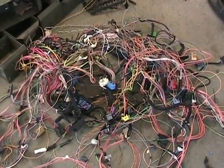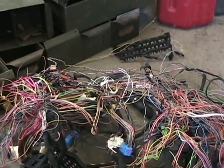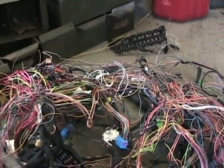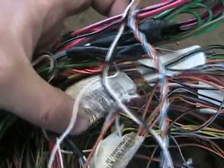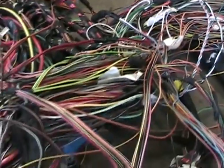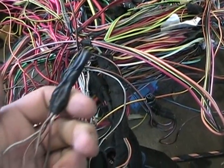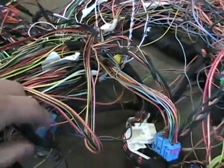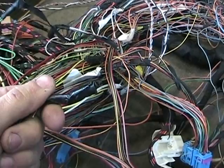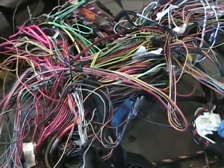Now I'd like to compare that to this. What you were looking at is the harness out of a 2000 Jetta GLX. All this was originally taped up as one giant harness, even though the radio harness, dashboard harness, and whatnot were all separate pieces inside. You can see they've got their own part numbers on there. Rather than use those little multiple connections, they have taken all the wires and crimped them together and wrapped them in tape, making it nearly impossible to simply add something or take something out. This is buried so far up in the dash — all this stuff was zip-tied in behind the giant crash brace below the windshield, and there is no way to get at any of this without untaping the whole harness.